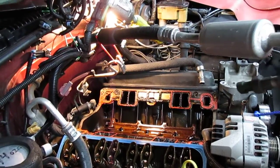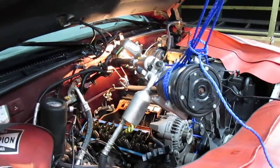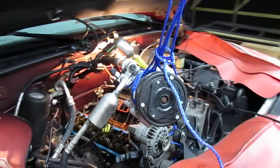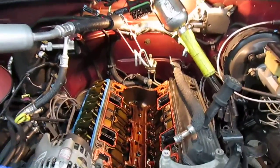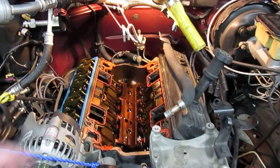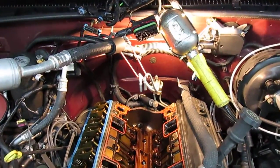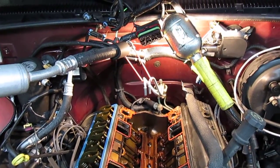You've got to remove a lot of things. As you can see I've got my compressor here suspended up out of the way. On the Vortec there's just a lot of things you have to move — you've got this EGR pipe here that has to come off, you've got to tie up all of your wires, and your fuel that comes in the top of the manifold has to be pulled up out of the way.